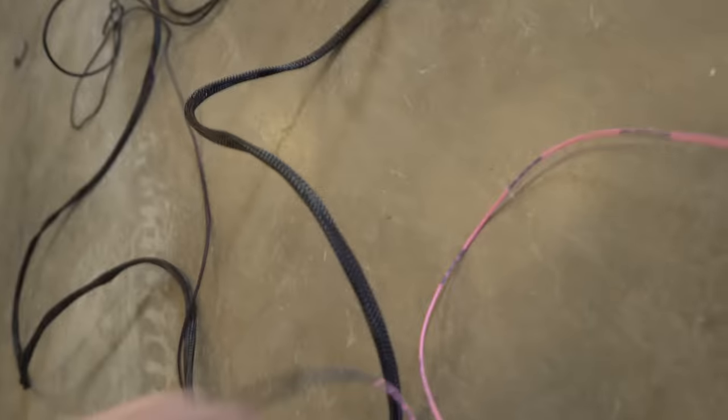It's on full manual right now. I'm putting air into each bag. The system is calibrating — it's supposed to be done on the ground with wheels on, but I want to verify everything is working before putting the car down. I'll let it calibrate now and recalibrate properly after the car is on the ground. I also need to be careful about the widebody — when it calibrates the car moves up and down on its own and I don't want to damage the fenders.